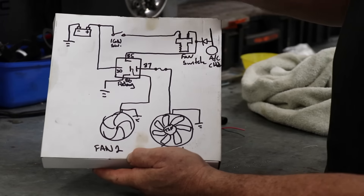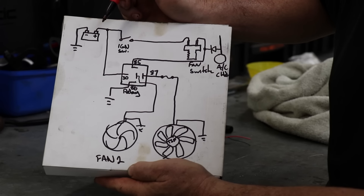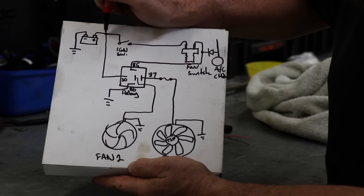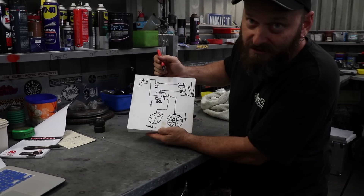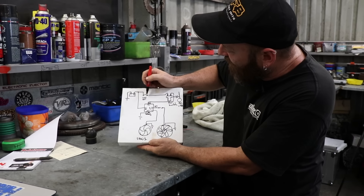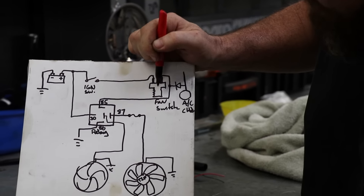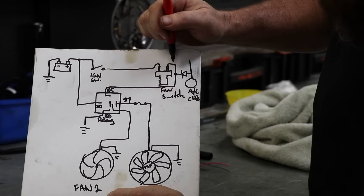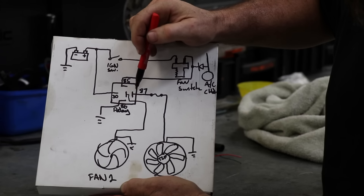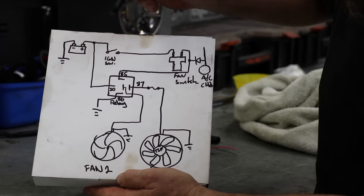Just make sure your relay can handle the load. Here's our battery. Pin number 30 on the relay — these pin numbers are Bosch numbers from way back in the day, but they're pretty generic. So pin number 30 is battery, and it also goes to your ignition switch. Don't just connect it to the back of your ignition switch — there should be a million of them everywhere; it's just power when you turn the ignition on. So that goes through into our fan switch. It's got two terminals — goes through, and if the switch turns on at 95 degrees, we get power on this side as well. Down to 85, through the coil inside the relay to 86, to ground. That pulls down the relay and we get power at 87. There are two 87s on a lot of relays. Through a fuse into your fan — fans work, done deal.